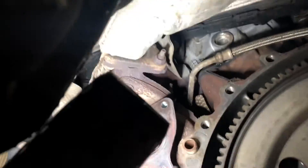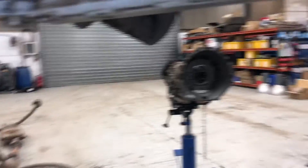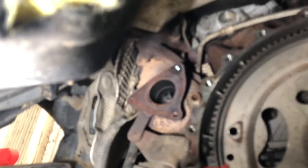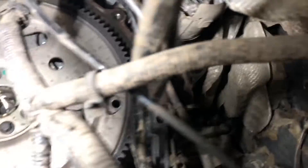That's probably about it for this video. We've got one repaired thread which we're happy with now, even if it was a bit of a challenge and a bit of a chore having to do it - all because we needed to remove the exhaust to remove the gearbox in order to replace the torque converter. That was our original job. We will now be able to get on with replacing that gearbox, and we'll clean out those other two threads and the two threads on this downpipe as well - nothing serious, we're not looking at doing another thread repair, we're just going to clean the threads out. There's our helicoil kit, right angle drill, the drill bits I used to start with, the rest of the bolts for those downpipes, and two downpipe gaskets.